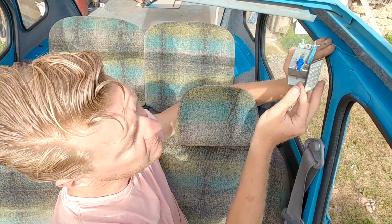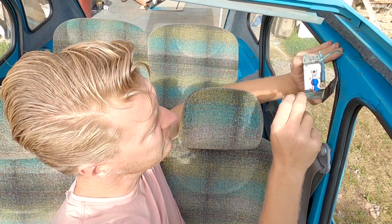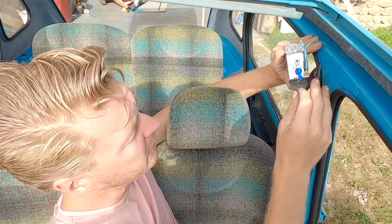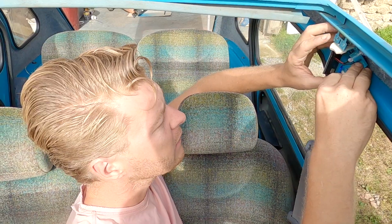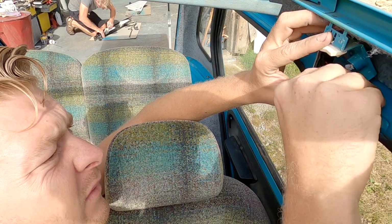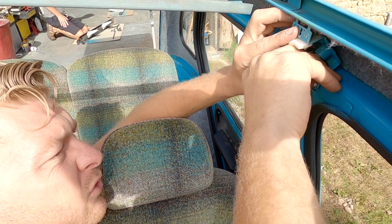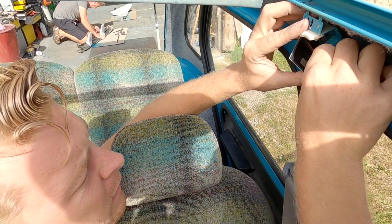So here's my LED panel that I'm going to be fitting into, well, I've already really fit it into the interior light. Now I've just used a slip connector over the back of the bulb holder, so our switch will still work. And if I screw this in, my earth is of course to the screw that it was designed to earth through, so I haven't removed anything, it's completely reversible, hopefully. It's a bit fiddly.